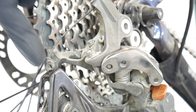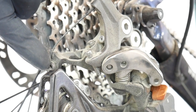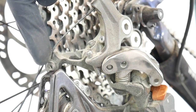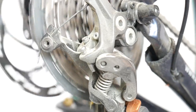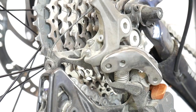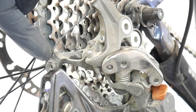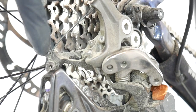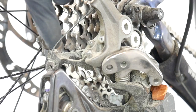Do you know when it snaps? If this bolt is over-tightened, because when we over-tighten this bolt we squeeze the cable right here, and then we only change the gears maybe 200, 300, 500 times and finally it will just snap. So do not use too much force on your bolts when you assemble the cables — both rear derailleur, front derailleur, and your caliper brakes — and you're not going to snap the cable by breaking it.